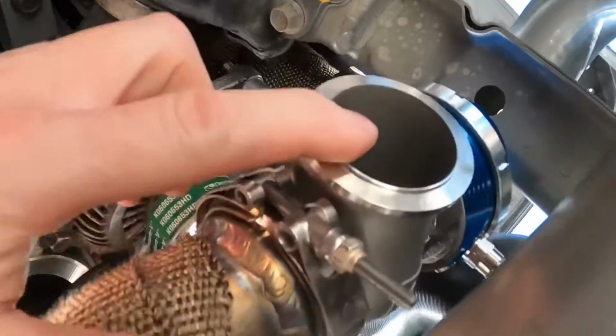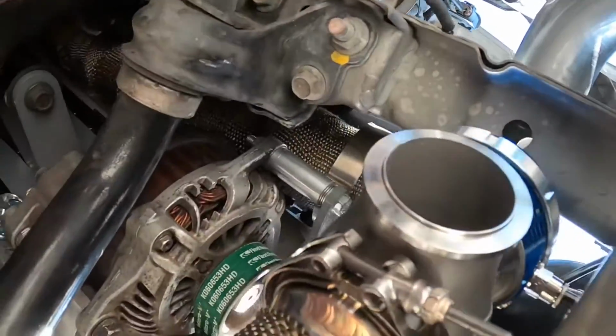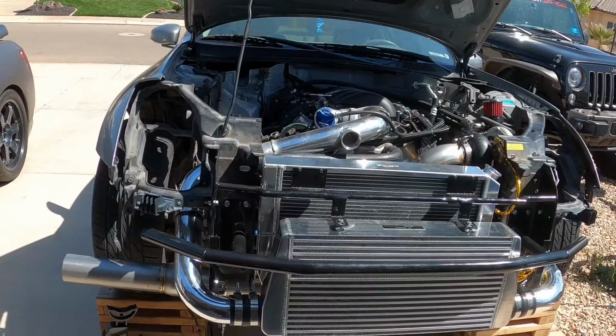So I did get vacuum lines run for the wastegates. So now I just got to build a dump tube for here, a dump tube for this side, and I'm probably going to angle this one back this way and then just kind of 90 off of it and come straight down. And then this one I'll just 90 off and come straight down right where it's at. So yeah, I'm very close to having it wrapped up. Actually, I got to get the power steering pump back in, get those lines hooked up, and besides that, everything else is all run on it.